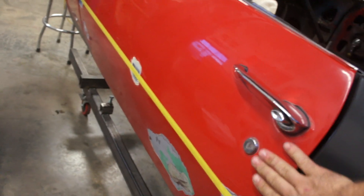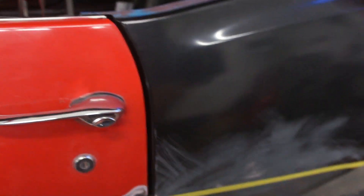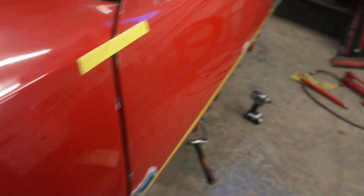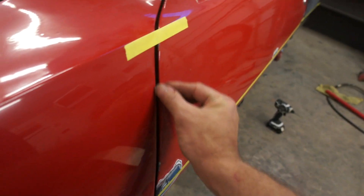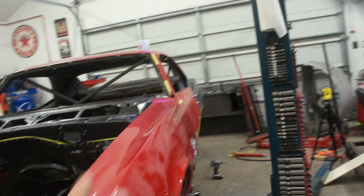I've seen guys — and I think it's a great idea I'm probably going to do — when they're doing their filler, they'll leave a little bit of filler in the gap to keep the panels together so when you're standing across it, it just stays one panel. We're talking just a skim coat, and you're going to cut that back out. This will all be metal, so I'm not going to cover my whole car in Bondo. But one of the top guys does that — leaves just a little filler in the gap and makes the whole thing one panel. When you look down this car, I want it to be like a piece of glass.